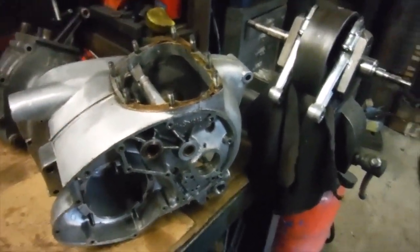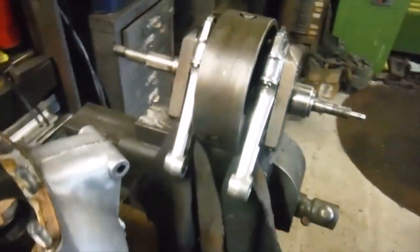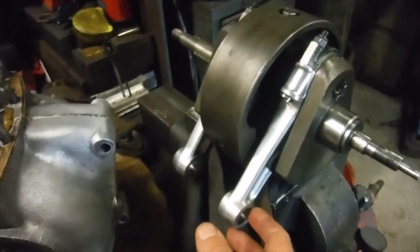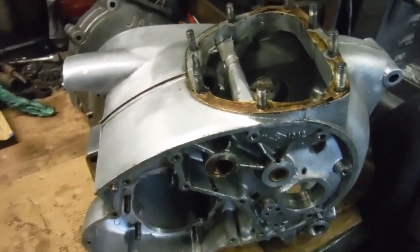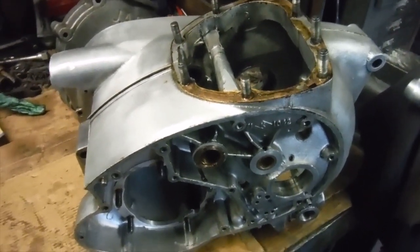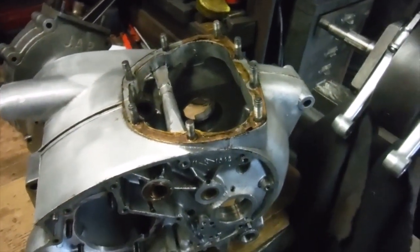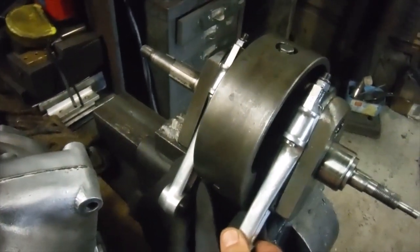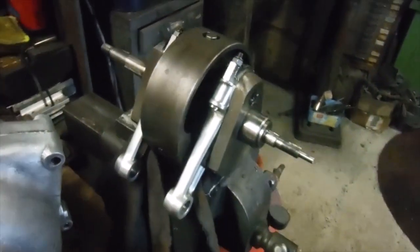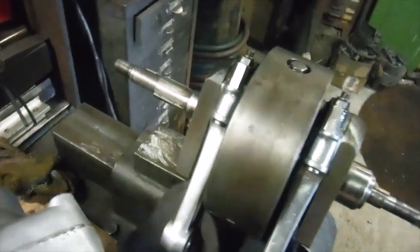Here we are with it in pieces, so I don't really know what the story was there, but I've got to put it back together. I've had the crank back from being reground and I've just fitted new big end shells, so I'm ready to start looking and finding all the relevant bits and pieces to see what can be reused and what might need to be replaced. The crank was on minus 10, it's now on minus 20 with new big ends and it's all in very good shape — a very good grind as I always get from Aeron Comerford.